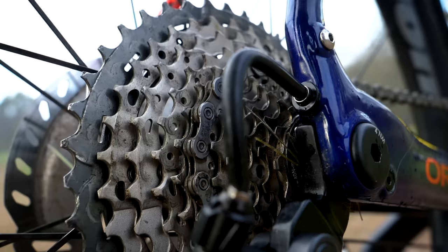How do you know which one to choose? If you want a responsive, lively gravel bike with really wide tires, you're going to need one-by on there anyway — the choice might be taken away from you. If you like the idea of simplicity, slight weight reduction, and potentially a little bit of extra robustness, one-by definitely has the edge. But two-by ain't dead yet — far from it. It's tried, tested, more refined than ever, and as long as your tire choice and frame choice don't preclude it, it is a fantastic option. A lot of people will still be swayed by those smaller jumps between the gears while still getting a wider spread of ratios overall.